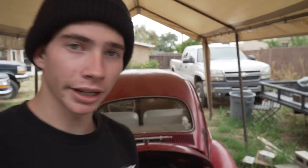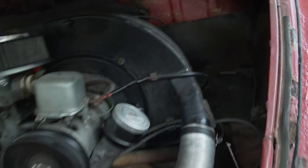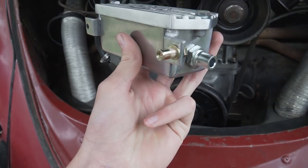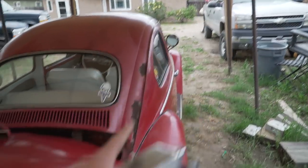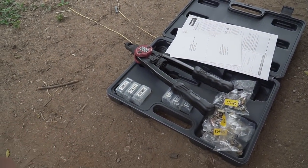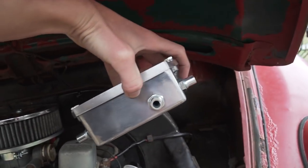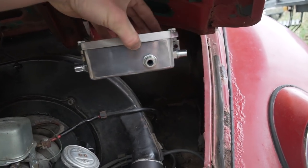I've been doing some research and looking at the car to decide where to mount the oil breather box. I've come up with a mount on the firewall — I actually cut out part of the mesh or cardboard up on the firewall and I'm going to mount it in this area. I have a nutsert here for mounting: the piece gets pressed into the firewall and it'll just be a quarter-20 bolt. This is very similar to how we mounted the mirrors. I'll mark the holes with a sharpie, drill it, press the nutsert in, and bolt the breather box up.